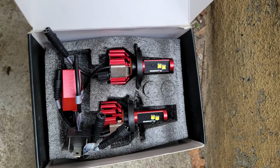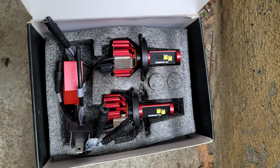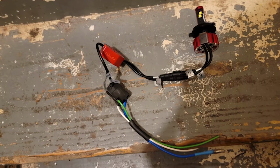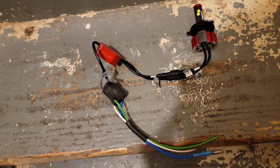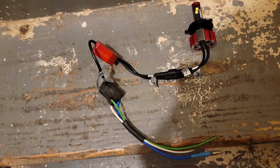So I made my own connector with a way thicker wire, and I decided to run one of the LED bulbs that 2J actually had given me some time ago. An LED bulb will be much easier on the wires given their improved efficiency over halogen. The downside is the complexity of the wiring they need, but I wasn't too worried about that because the inside of the headlight bucket had plenty of space now anyway.